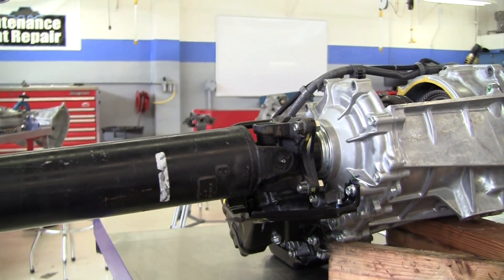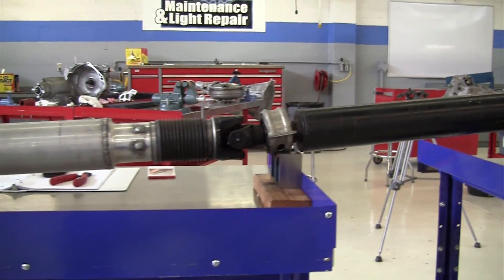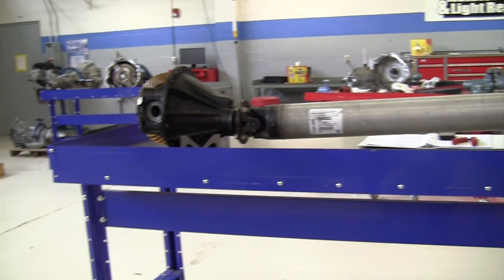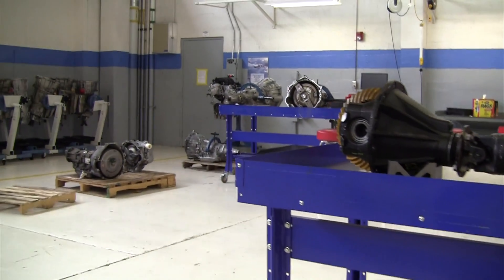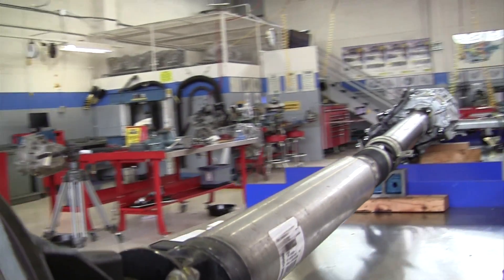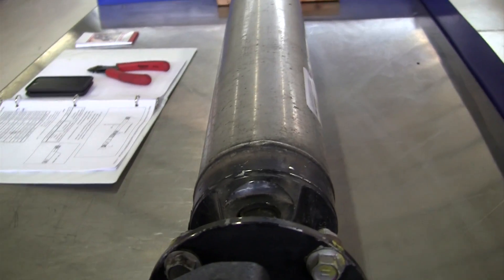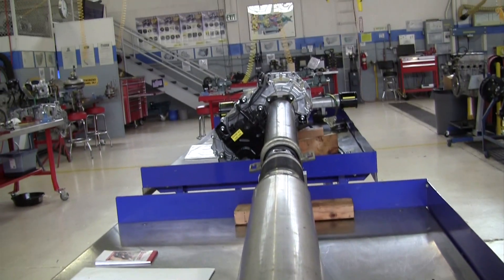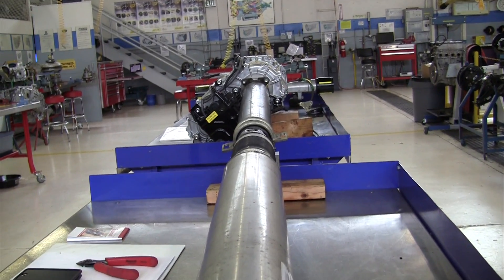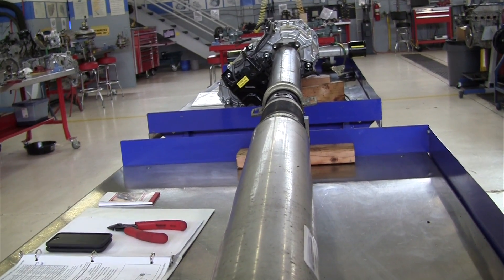This has been a demonstration of how to measure proper U-joint phasing. Phasing means it's a measurement of how closely all the U-joints are lined up together. As you look up the shaft from the rear U-joint forward, all those U-joint bearing caps need to be lined up together within plus or minus 3 degrees — preferred, of course, would be zero.